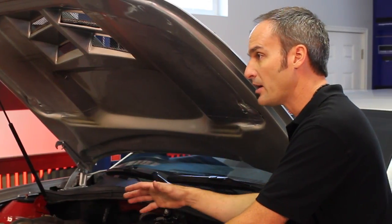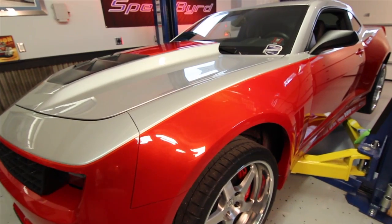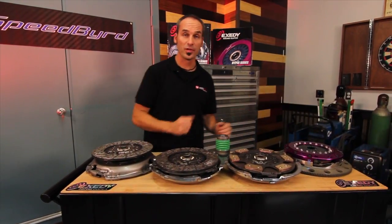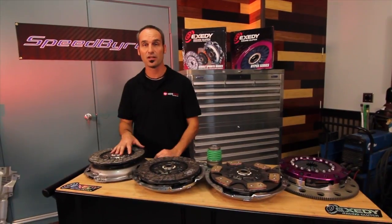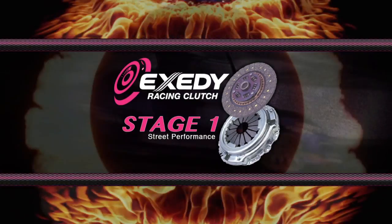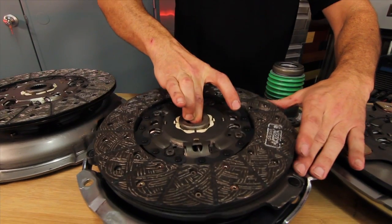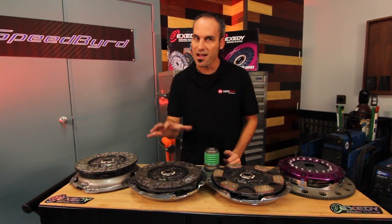Let's check out some of our options for Camaros and see what you guys can pick out for yourself. How do we decide what kind of clutch to put in that Camaro? This Motivicity project car is a thousand horsepower at the tire, so we're not going with an OE clutch. Exedy is one of the biggest clutch manufacturers in the world — you're probably running one in your car and might not even know it. Moving past the OE, Stage 1 gets a little more aggressive organic compound on the disc and a higher clamp load on the springs, giving about 25% over stock in torque capability. That's not going to do it for us.